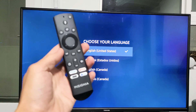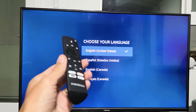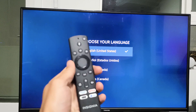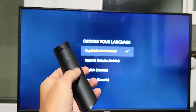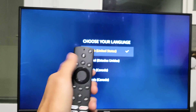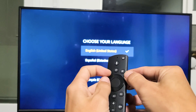If it's still not working, take your batteries out, put them back in, and then try the home button first. If that doesn't work, try the three-button combo. If that still doesn't work, replace your batteries with new ones, then press and hold the home button for 30 seconds. If it doesn't work, press those three buttons and hold for 30 seconds, and see if that works.